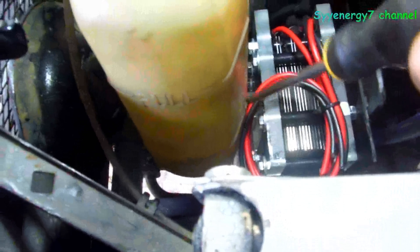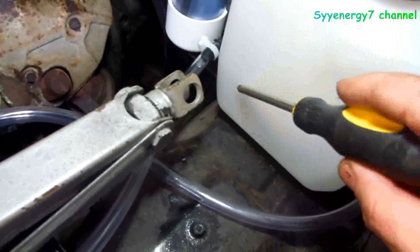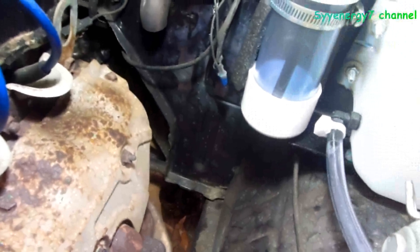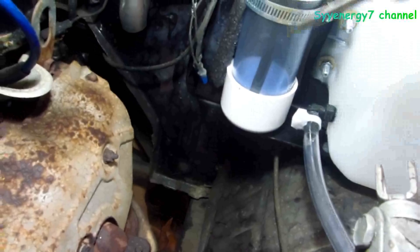It comes out the top of the dry cell and goes into the bottom of the reservoir tank. The electrolyte is in there, it bubbles through the electrolyte, comes out here, and then goes down through this hose. This section has plain water — no electrolyte — and it bubbles through the water. This is a safety check in case of a backfire, since the gas is only being made on demand in this little unit and isn't stored anywhere.